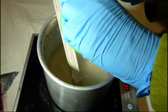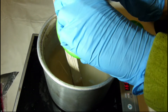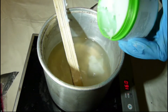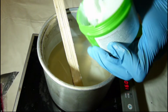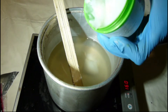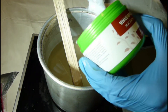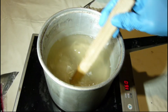For waxing bicycle and motorcycle chains it is better to use more paraffin wax and less grease. Usually 60% wax, 20% petroleum jelly, and 20% grease will be preferable. If the grease is more than that the mixture will be sticky and will attract more dirt. A mixture of 50% grease to 50% wax is more like an actual grease, and that is more suitable for lubricating door hinges and similar devices where regular grease is not very appropriate.